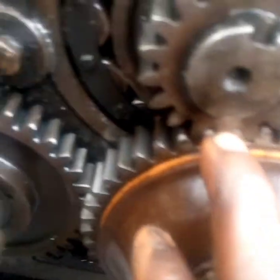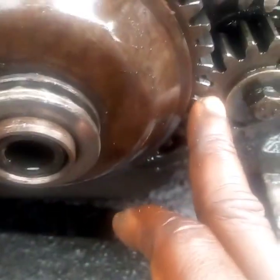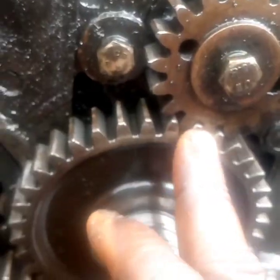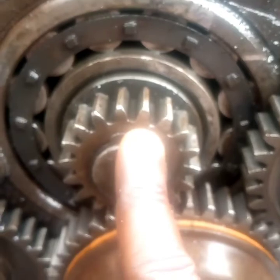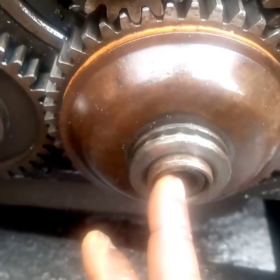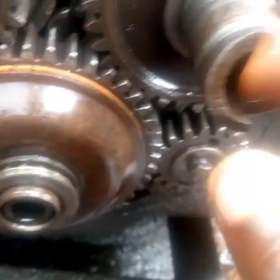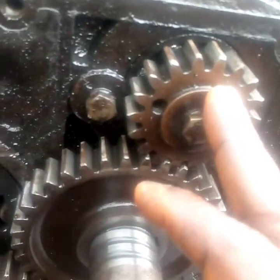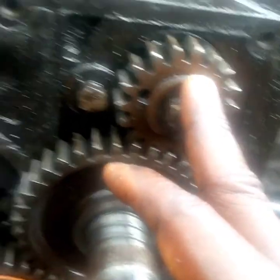This is how to set the timing of a China engine 1130. You can see it is numbered: one-two-three and double zero. One-to-one is for the crankshaft, two-to-two is for the camshaft, three-to-three is for the manual winder gear. This is the camshaft, and this is the link that connects all the gears together. This is the manual winder where you revolve the engine manually. The counterweight goes up and down — this is the upper one and the other is down, and it has zero-zero.